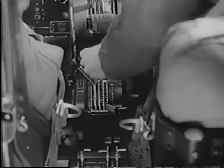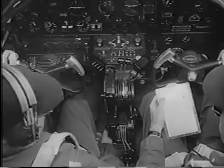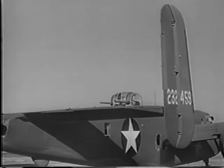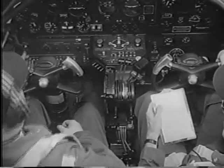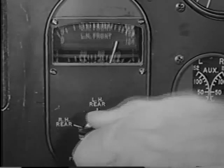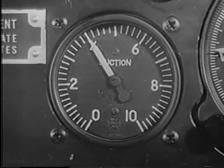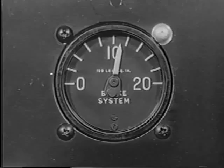There's an alternate method of starting which many pilots prefer: you can engage the starter and prime as necessary while the engine is turning over. Idle and warm up your engines at 1,000 to 1,200 RPM. They are not warmed up to a safe point for takeoff until cylinder head temperature registers 150 degrees and oil temperature 40 degrees, at which time the oil cooler shutters may be opened. Next, both pilot and co-pilot go through the checklist item by item: nose gear locking pin — checked; automatic pilot — locked off. Check your flying controls for free and proper movement. The co-pilot looks out to watch the movement of rudders, elevators, and ailerons. Continue the checklist: de-icer control — off; pilot hatch — closed and locked; lower turret — retracted; all hatches closed.